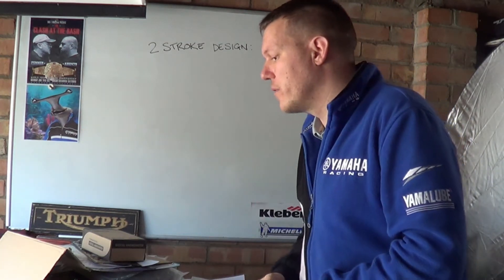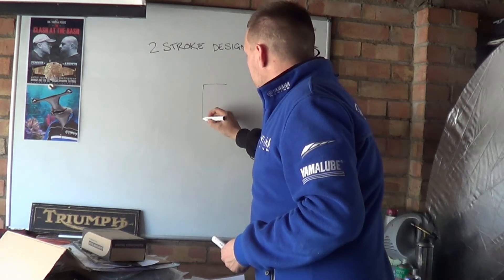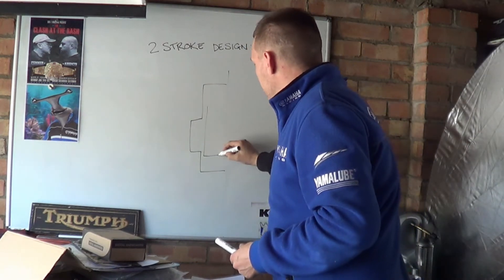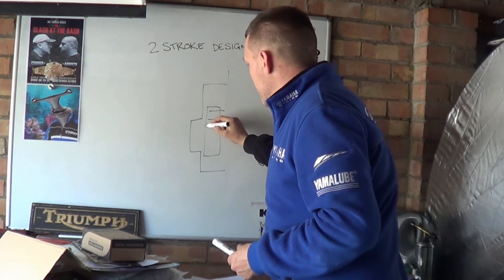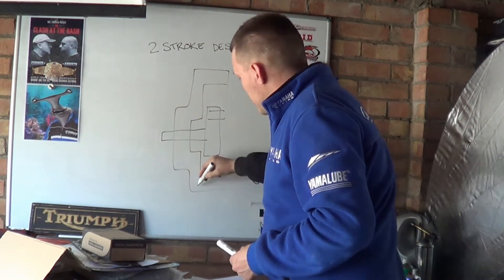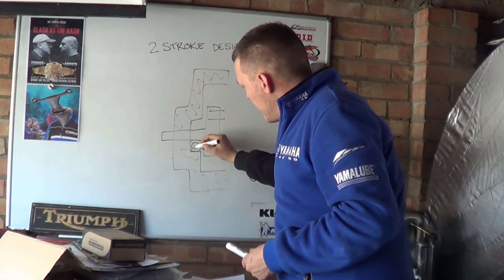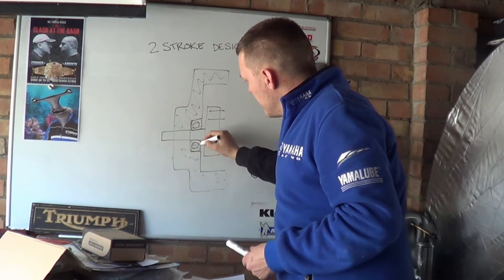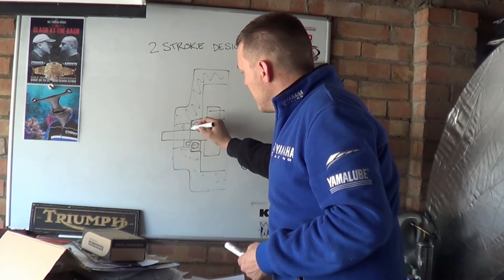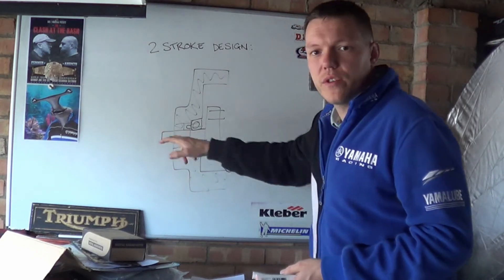There were a lot of great comments, and one comment that came through literally an hour ago — so I thought I'd jump straight on it — is: you have your crankcase of a two-stroke, you've got your split, you have your wrist pin and what have you, and then you have your shaft coming out. There's your casing, and then you have your bearing here, and then a lot of times you have a shoulder and then you have your oil seal. The comment I just received is: why can't you move the bearing to the other side of the oil seal?